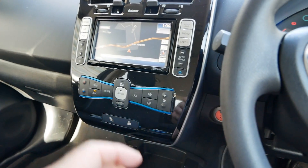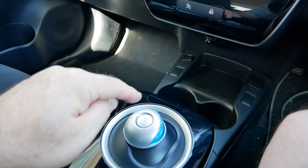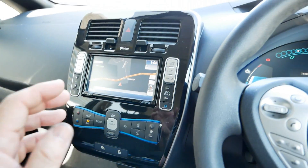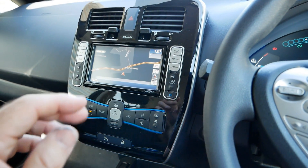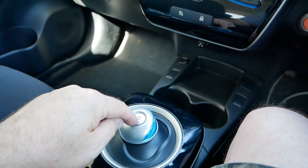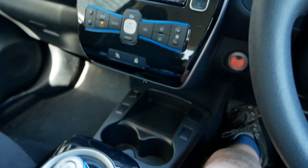When you're parked, you want the weight of the vehicle on the handbrake, on the back brakes, and not on the transmission. That's important whenever you're parked but it's crucially important if you're parked on a hill or a slope, because damage will occur more quickly if you're selecting park first and then going for your handbrake.